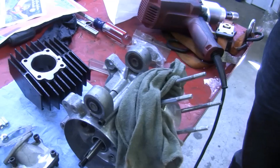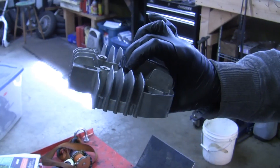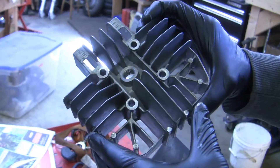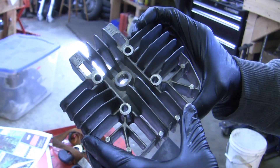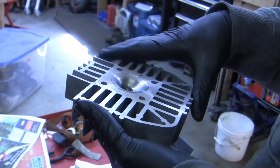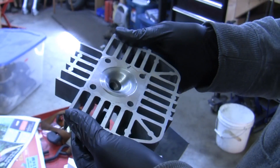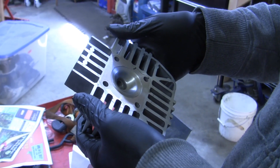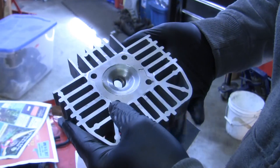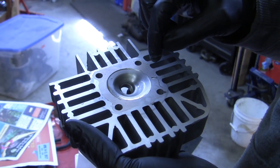So for this build we received a custom cylinder head from Graham Mottzig. This is a casting from a Jia Ling Hobbit clone motor. The main points are that it has a silly amount of fin area, and importantly it doesn't have a decompression port in it. The core itself is pretty cheap, but the cylinder head and machining done to it is a donation from Graham Mottzig. What he did was get castings from somebody else and machine them at his place of work to what he claims is a very good cylinder head design.